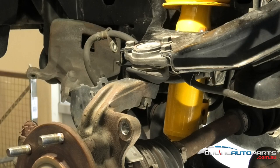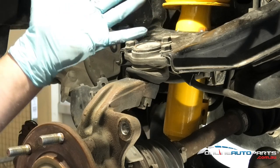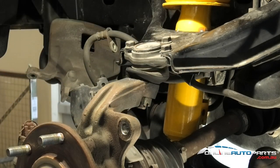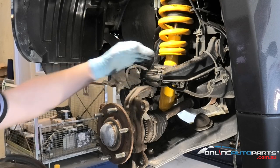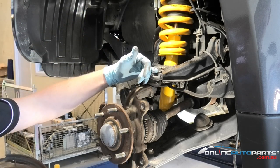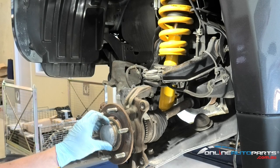If you do have a pressing style ball joint and you've had the ball joints replaced a couple of times on an old vehicle, just keep in mind that you might need an oversized ball joint. With the bolt-in ball joints we're looking at today, this is the standard OEM style that bolts into the hub. On independent front end suspensions like in your four-wheel drives, you'll have two ball joints - an upper and a lower. On Commodores or Corollas, you'll find one lower ball joint. Ford Falcons do have two ball joints, and the lower Falcon ball joints are very common to need an oversized replacement due to frequent failure.